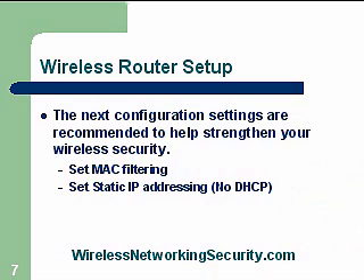We need to turn off the DHCP and set static addresses individually and manually to every computer, every node connected to our network. Also, MAC filtering — the MAC is a physical address, 48 bits. Every device connected to your network has a MAC address, so we can identify what those are and input them into our network so that the router will only allow those particular MAC addresses to connect.